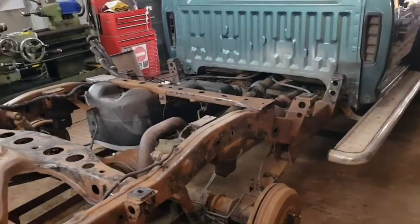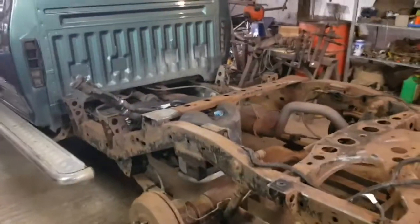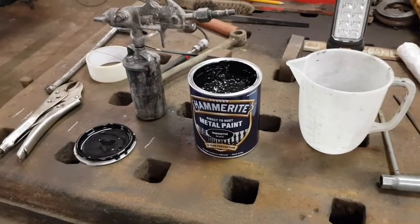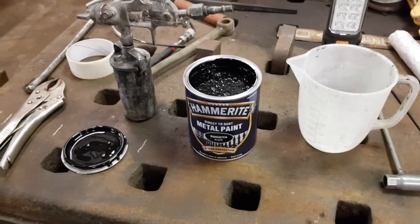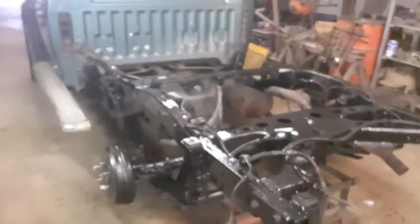So that's where we're at — today I'm going to mask this up and hopefully get some paint on the chassis. Here we are masked up. If you wanted to do this properly you would drop the fuel tank out, but we're not going that far because this is a tipper build, not a complete restoration. Paint-wise, we're using good old Hammerite smooth black — nothing special. I'm not going down the lines of two-pack, primer and top coat — Hammerite will do the job. One coat, maybe two, and already it's improved things nicely.